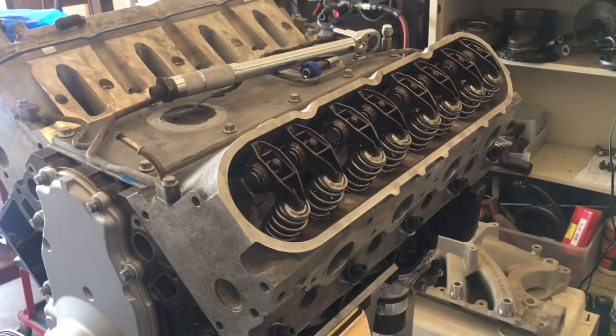I'm going to live with that. I think that's a really good compromise. I'm above one full turn, so at least I know I'm in the ballpark — I'm not too deep, and I'm within a reasonable proximity to all the other rockers. I could technically have run that 7.400 pushrod at 80 thousandths preload, but I just chose to go spend the extra seven bucks and make it closer to the rest so that everything's happier and more fluent.